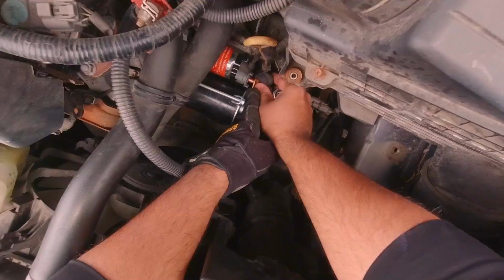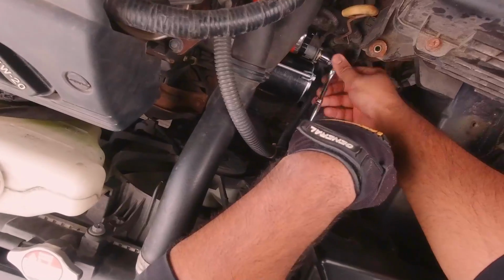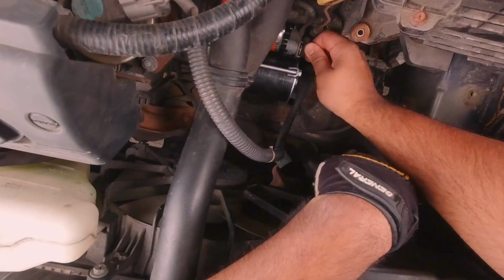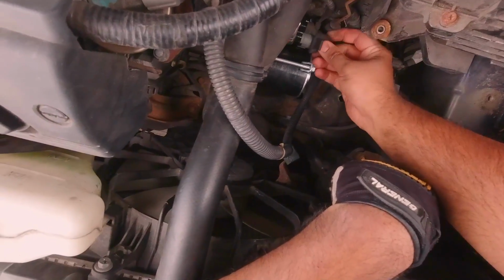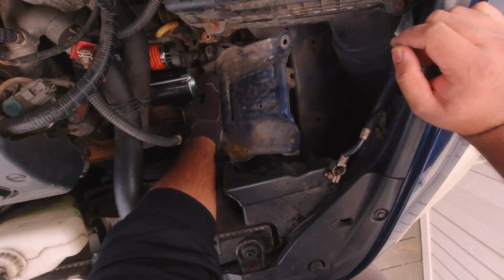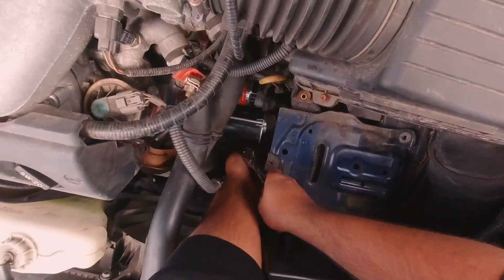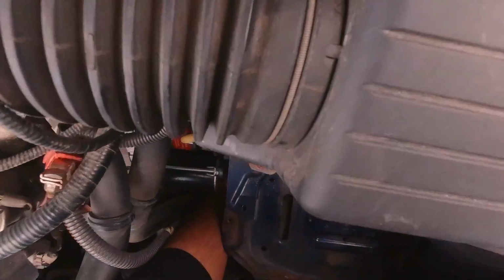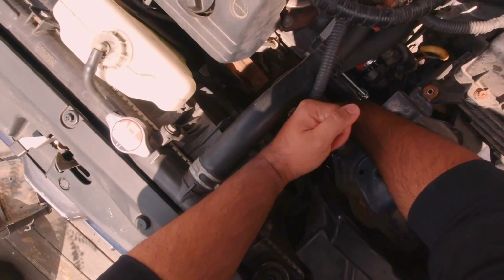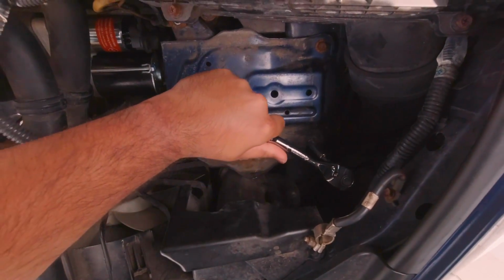Then tighten the washer nut for the electrical connection with a 10mm socket until it's snug. Finally, cover the connections with the rubber boot. Seat the battery tray on the two bolts and press it down until it's firmly seated. Tighten the two 12mm bolts. Tighten the remaining bolts on top until snug.